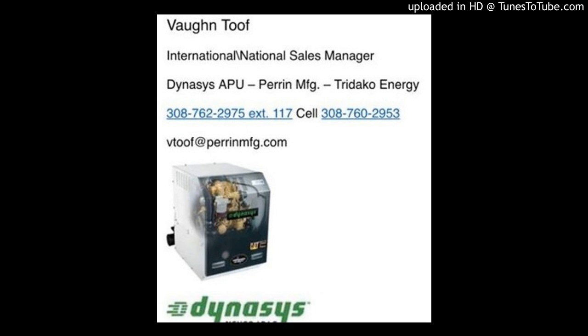I see there are financing options I've been looking at with you guys. What are we looking at per month to save with just the SL? Right now at your estimated cost — in Alliance, Nebraska our diesel prices are pretty cheap, we're paying $3.40 a gallon. I know California is a lot higher. But right now at $3.40, you're saving between $600 and $800 a month compared to idle time. It depends on how much you idle. If you idle at least 8 to 10 hours a day, your sleep or bunk time, you're going to save a minimum of $700 a month.